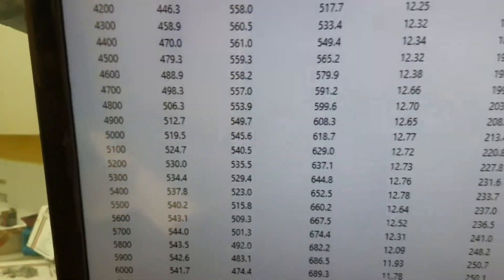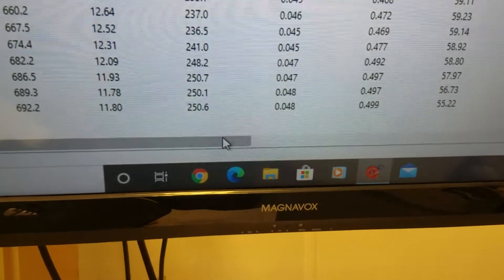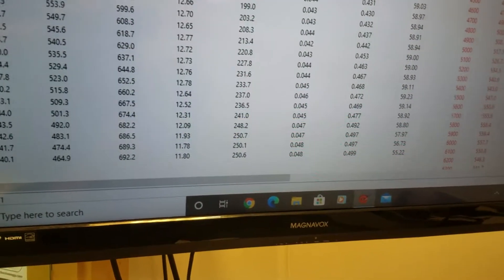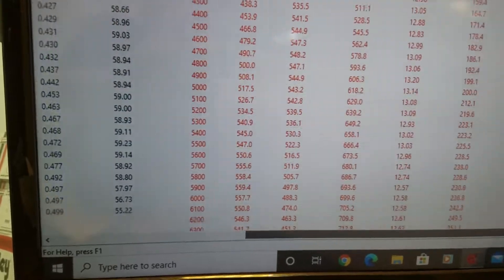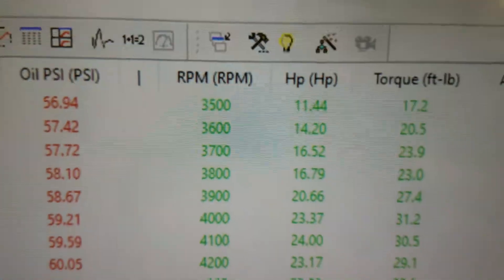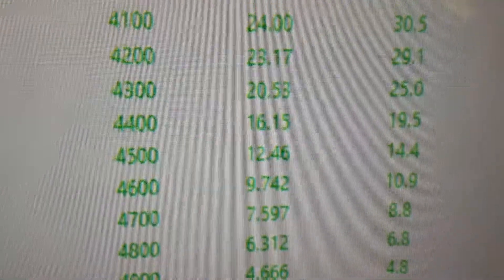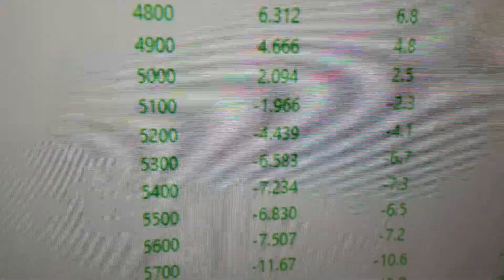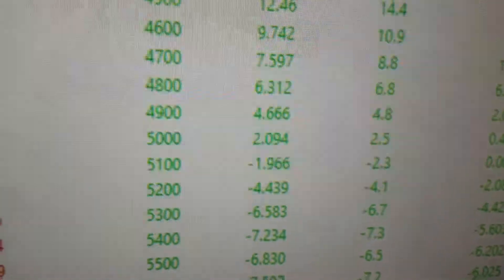So if you kind of watched the videos earlier, we just ran one earlier in the day — same motor but with a Victor Jr. on it. We're going to show you a comparison here. Interesting — so this motor with the air gap on the bottom is up 17, 20, 27, 30 pounds of torque. You can see how much better it is torque-wise. It gets to about 5100 RPM and it flips — then it's down about 15 to 16 horsepower. So that's the difference in the two manifolds; it just depends on where you want it to run.